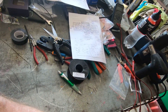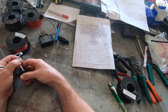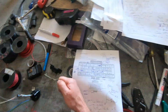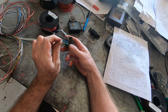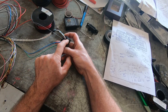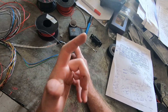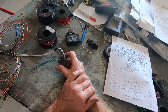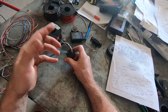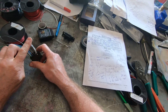In the next row I've blanked off one for the map sensor — that's the one I'm not using. I allocate Volt One to the map sensor if I'm doing an Atom build, and sometimes if I'm doing a generic loom I'll run the wires so I don't use it for anything else.